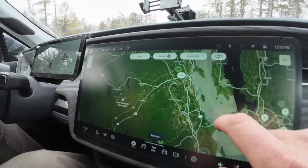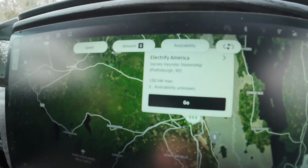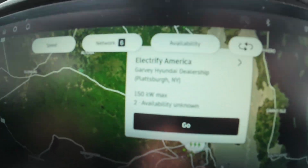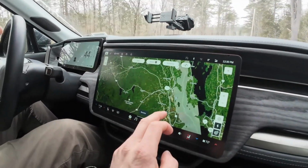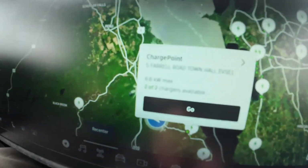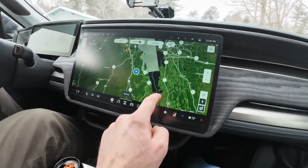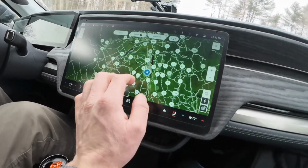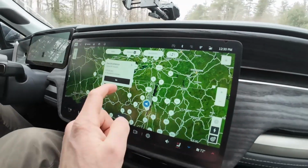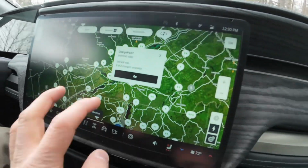See how all this data can be confusing? Yeah. Once you're in it and you live it, it becomes very, very general information. It doesn't seem confusing anymore. But you still have to know what you're doing. So we can stop at a fast charger today, a level 3 fast charger, that's only 150 kilowatts. That's fine for us if we're, say, 60, 70, 80% battery. That's all this vehicle is going to pull from the charger anyway. Gotcha. Even though this one could take up to 220, 230-ish, it's not going to pull that because as the batteries fill up, as they become more full on charge, they slow down the charging ability.